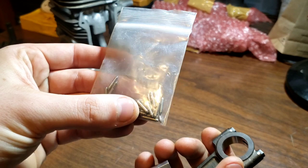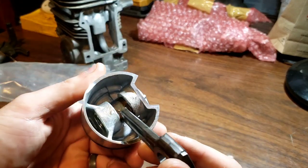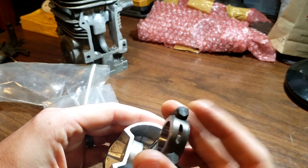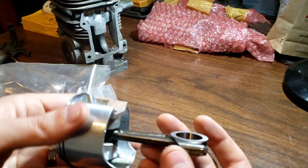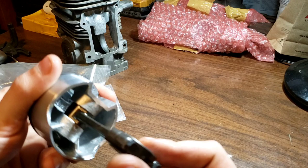This rod comes with roller needle rollers — you have to use their piston pin when installing this assembly. As you can see, it fits beautifully in there. Quarter-inch rod bolts, hex head, so getting them in and out is pretty easy. This is my first billet rod to install, but I know guys running them.